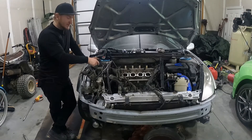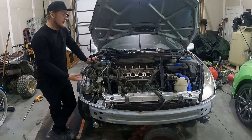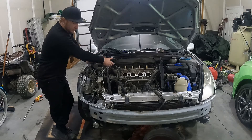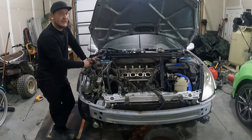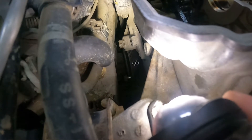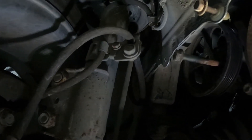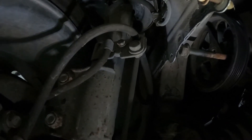I'm to the point that now I just need to remove my motor mount. There are a couple of bolts that are impossible to get to with the motor mount still attached. You have to lift it up to get the tensioner bolt out and then you have to lower it down to get the power steering pump bolt out. That bolt on the tensioner has to come out but the frame rail is right there, so you're going to have to lift the motor just above there so that it can come out of the way and you can get the timing chain cover off. And then the other problem piece is this bolt down here — it comes out so far and then hits the frame rail, so you're going to have to lower the motor to get that bolt out.